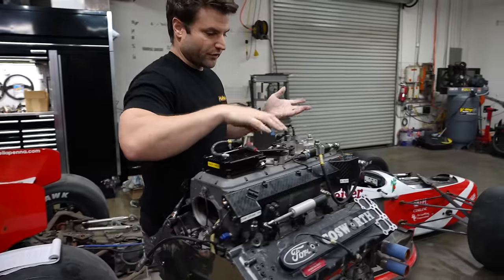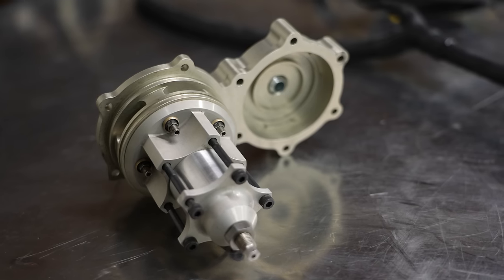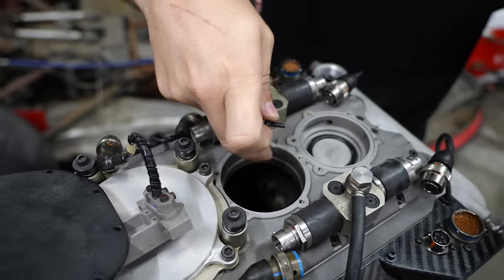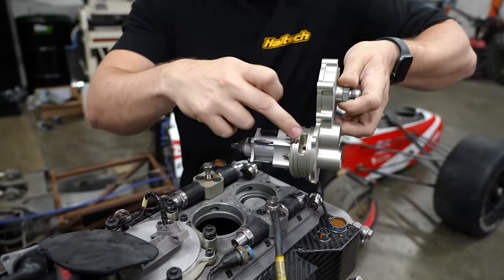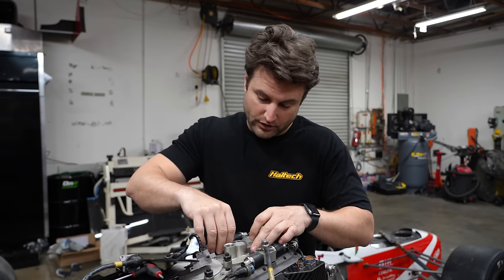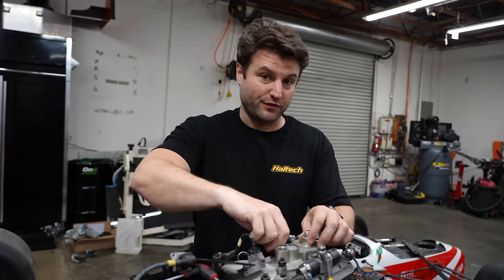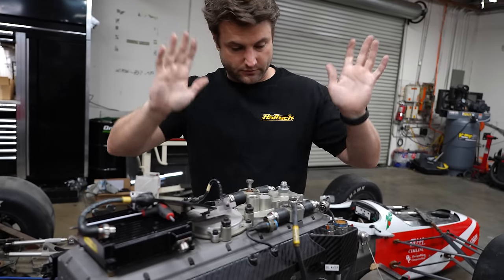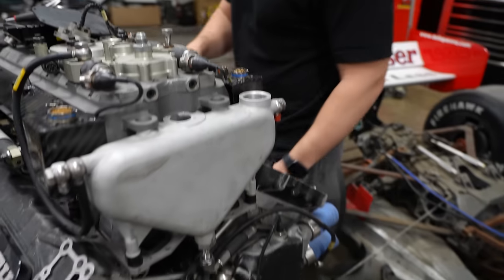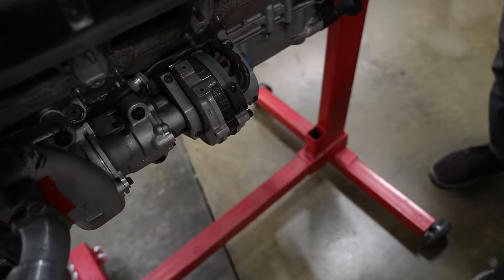From a video maybe six months ago, we figured out that this is actually a fuel pressure regulator. There's a hole that connects this fuel sensor to a double O-ringed area here. The fuel pressure regulator is actually built into the top dome with a mechanical fuel pump — probably the most efficient approach. Turbosmart and other companies now make more compact, high-flowing regulators, but this is simply fuel in, fuel out. The connector down here goes all the way to the alternator — fuel, air, spark, so far so good.